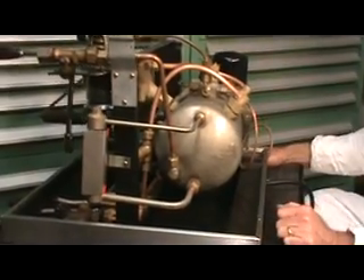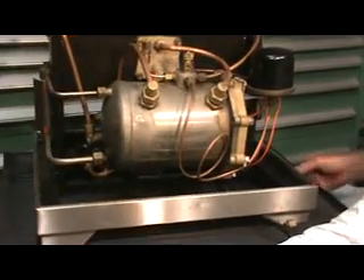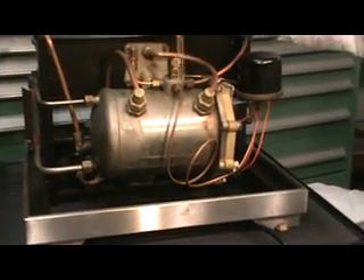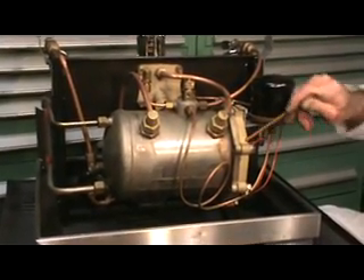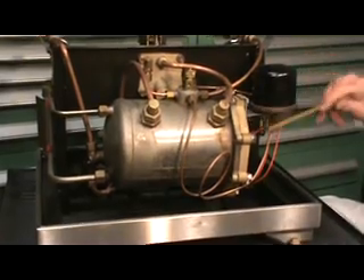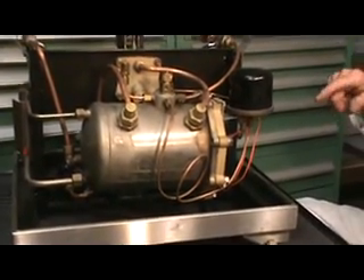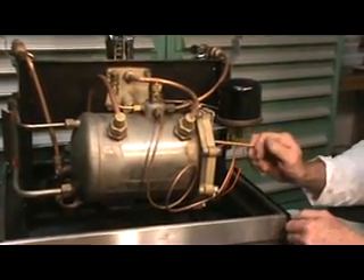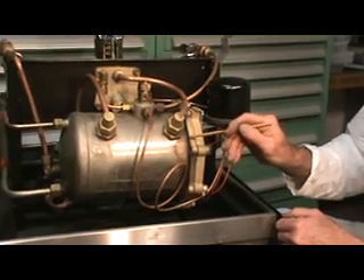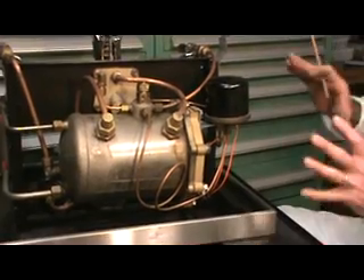Here's the inlet — the cold water comes in. The heat exchanger goes through and comes out and feeds the group. Very thick boiler plate. It has an interesting inset seal and ridge system — it's not a flat plate to a flat plate. It's actually a fat ridge on this side of the boiler, and on this side there's a flange that sticks in and seals.